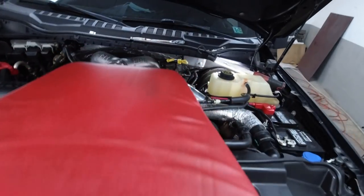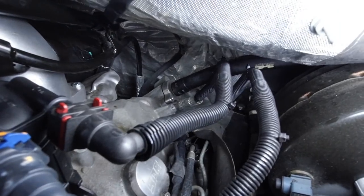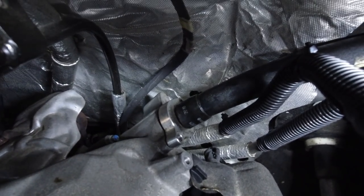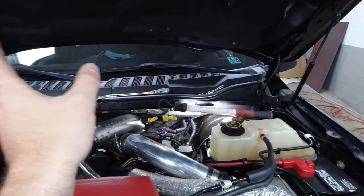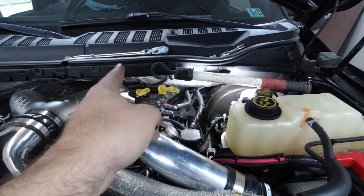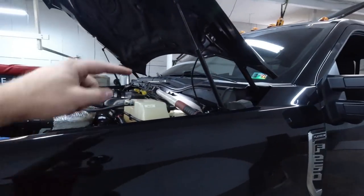I went through and already popped the two bolts out of the CCV kit. You can see back there we have where the hose connects to the fitting — that is the port for the CCV gas to escape from. How the CCV reroute setup works is the hose goes up over the brake booster. You can route it whichever way you want — a longer hose running out the back, into the exhaust, however you want. I just kept the basic hose included with the kit; it goes off that fitting, up over the brake booster, runs down behind the fender.